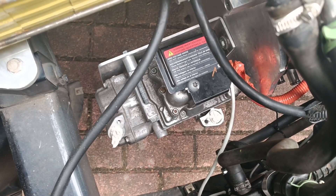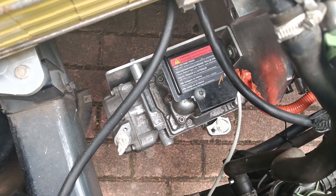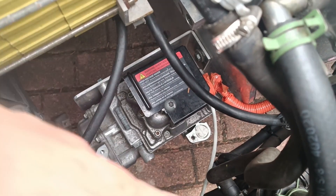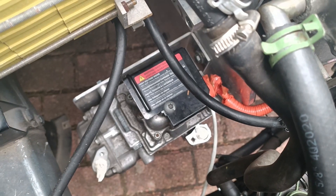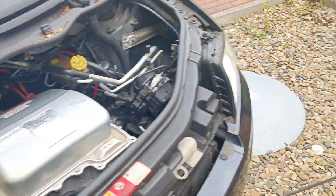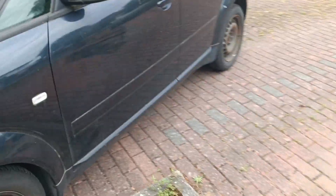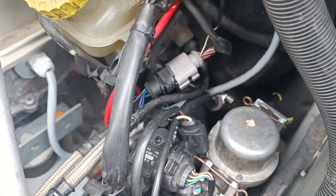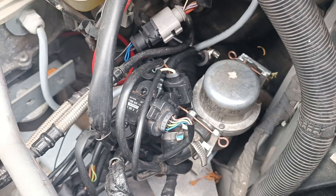The car will also have air conditioning — we mounted a Nissan Leaf AC compressor. We used the inverter as a junction box, forking off the high-voltage orange cable there. It's LIN bus controlled, so the little white cable contains 12-volt and LIN bus signals and is controlled by a VCU. The VCU is basically under the floor carpet here, and I've reused all the existing wiring with new signals, buying the counterpart connectors for the various plugs which all follow a common standard.